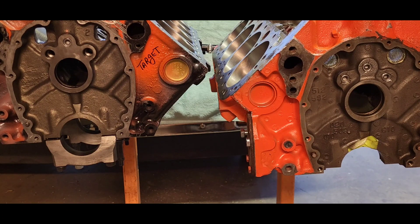When you install them and do these tests, you know it's right — you can feel it. If someone asks you how it went, you answer: it's perfect, with a ton of confidence in your voice. I put the pipe plugs in dry and torque them to 20 foot pounds, but you should consult with your machine shop and do what they recommend. The blocks come back from machining and almost always have sealer on them, and I might use sealer on them also depending on what they say — after all, things do change.